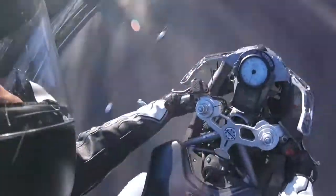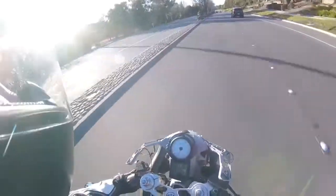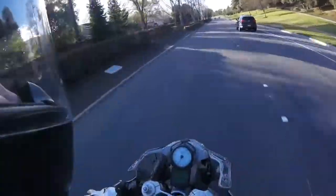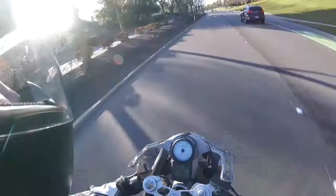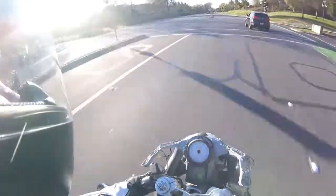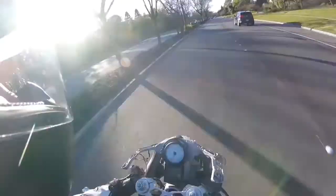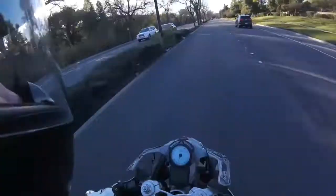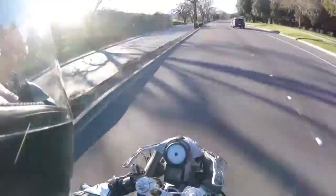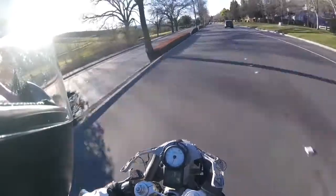Whereas on an R6, like I've ridden an '08 R6, which was my most recent R6 ride, you crack the throttle just a hair, the RPMs jump up to like 10,000, you engage the clutch into the friction zone just slightly, and they dive way down, and then you have to compensate with the throttle, and then the throttle wants to wind the bike way up again. It's a balancing act that I feel is a little bit difficult for most people that are just getting used to operating a vehicle on a street for the first time, if that's what you're doing. So I would definitely advise staying away from the 600 and try to limit the amount of power that you have.